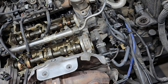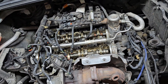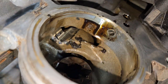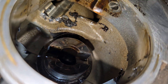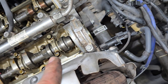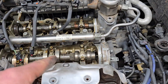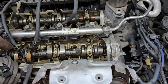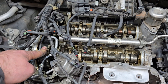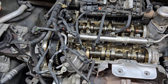You might wonder how that can make the engine fail. Well, if the vacuum pump stops spinning — and it's driven by the camshaft, keyed onto the axle — then obviously if that stops spinning, this camshaft will stop spinning as well. And then it will cause the timing belt to slip.